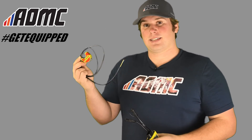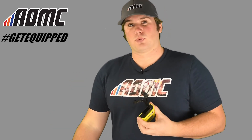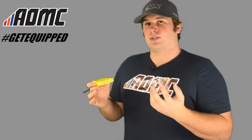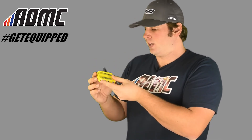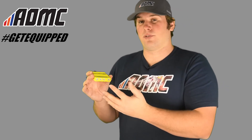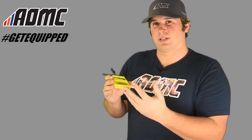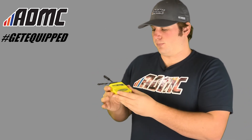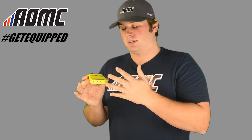You can do that with this, especially if you have a non-Japanese bike without a map switch like a Husqvarna or a KTM. But most of the time guys don't add the switch — they'll just leave it in the position they want from the ECU. More power, more usable power — it's 10 programs. You can change the fuel mapping however you want, get better fuel consumption, lean it out or richen it up. It just gives you a lot of options instead of the manufacturer's ECU box giving you basically one option. This has 10 pre-programmed settings, and you can do it any way you want for any track condition.